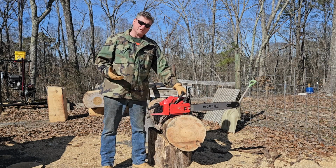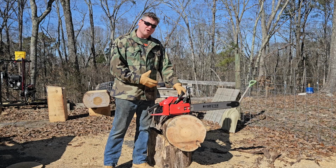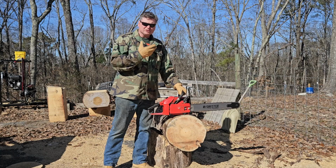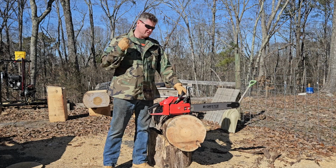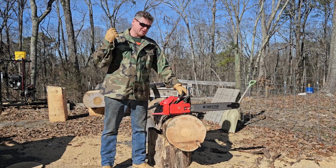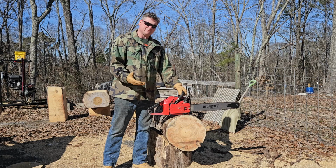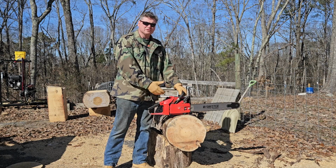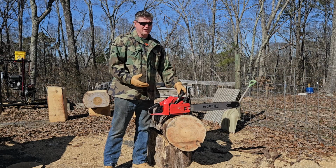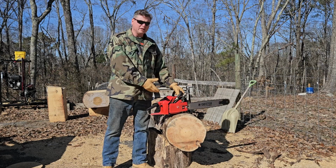I've had a few different people mention to me about the vibrations of these, because they are a smaller saw that they kept making bigger and bigger, which means the crank bearings, the cases, the crankshaft, everything was actually kind of meant to be for a smaller saw, and so the vibrations are amplified whenever you put the larger piston on there. This is a 49mm piston on a saw that actually is the size of a 55cc setup, so it does vibrate a good bit. I immediately noticed it right there.